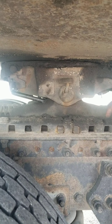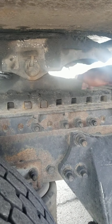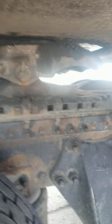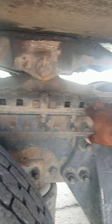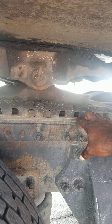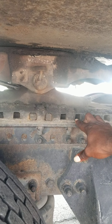This is the platform. The platform has not been broke or cracked, not missing nuts, bolts, or screws. It's properly mounted and secure. The fifth wheel sliding rail — this fifth wheel is not fixed; it has sliding locking pins, so it's adjustable. It's properly mounted and secure, not being broke or cracked.